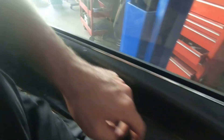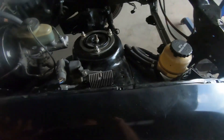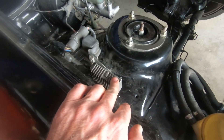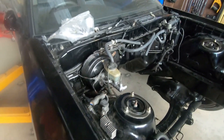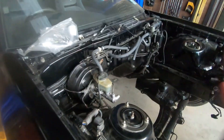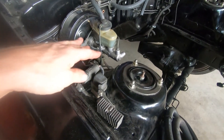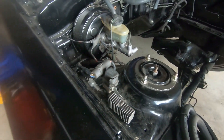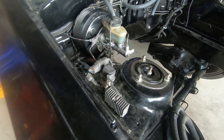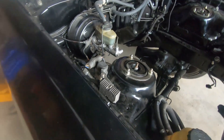I've traced the fuel pump wiring - that was positive. And the reverse lights - those were the two I wasn't sure where they went. This one actually has a fuel pump resistor and an extra relay. Normally they're switched by the airflow meter - when the flap in the airflow meter moves it fires the fuel pump, and then when you went into higher revs with more throttle opening it would clip the second relay and bypass the resistor. That is perfect - we will be using that system in the UZ and it'll work just lovely. That's what I did on the last one.